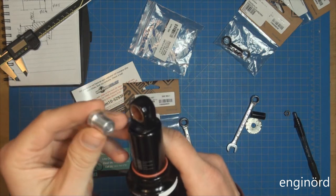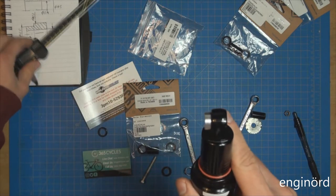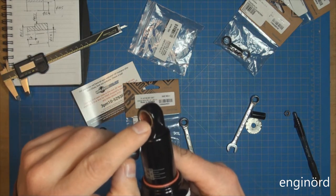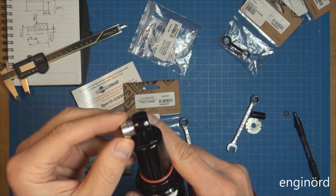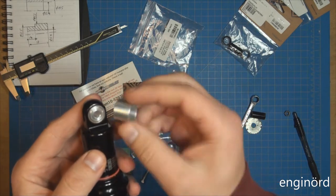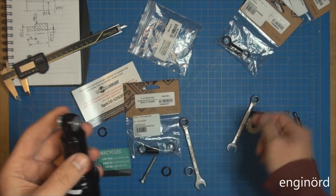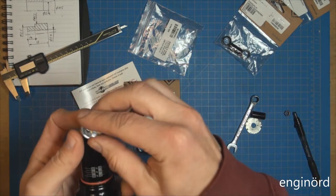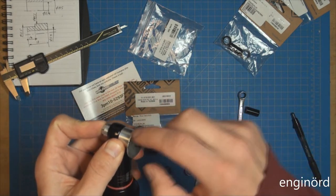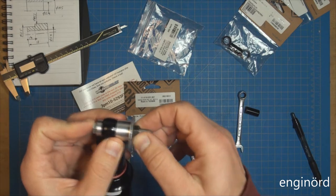So the bushing press plate goes in like that. It's a little sloppy. I made that diameter 12.5, and this is nominal half an inch, so 12.7. Could have made it 12.6. It's a little sloppier than I like, but it will work. And then here is the other bushing, and you can see that it will interface like so. Now I can insert the bolt, put that on, put a washer, find a nut, and hopefully keep all this assembly in a bicycle toolbox, in a well-known place.